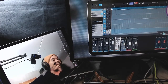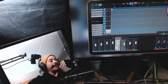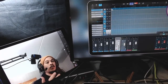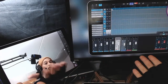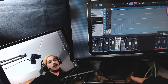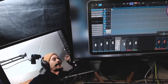Yeah, so this is what I wanted to talk to you about, because when it comes to repairing Apple stuff, it is way too expensive to do that if the unit isn't more than 2 or 3 years old. It's going to be stupidly expensive. And if you want to do it yourself, like I said, since the digitizer and the glass has been glued or fused together, you have to exchange the whole thing. Basically, what you're doing is you're breaking the iPad into two parts, and one of the parts has to be completely changed out. This is why the screens are so expensive. If you search for iPad Pro screen replacement, you're gonna find out that they're pretty expensive. It's because you're buying a completely brand new screen. You're not buying glass. You're buying a new screen.